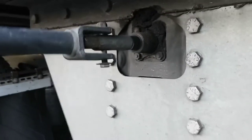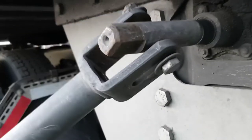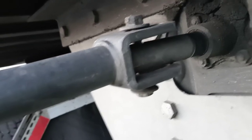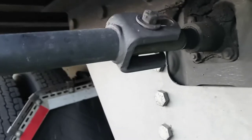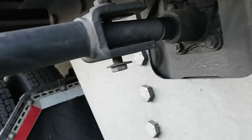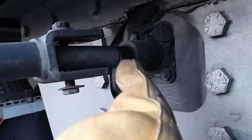Now in the low gear, I'm going to show you. You have this movement. I'm going to just push it in slightly — there you go. Now it doesn't have that movement anymore. I can still move it this way, but not that way. Push it in slightly, not all the way, because if you push it all the way in it's going to go into high gear.